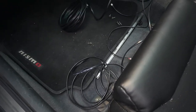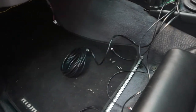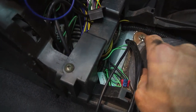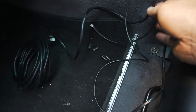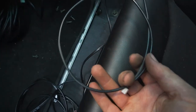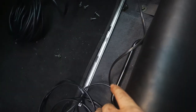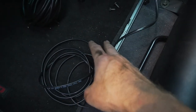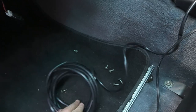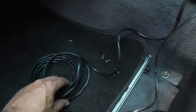What I've decided to do with running the wires is — because they're so short — I added a hole just next to the shift boot, as that was the shortest distance to get them through the firewall. I've got the two wires from the temperature and pressure on the oil gauge and they're only just going to be long enough to reach the gauges. I also ran a twin core wire for the coolant temperature sensor, and we've got the wideband sensor pigtail to go into the gauge.